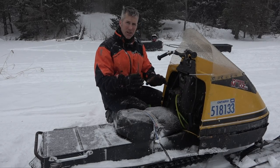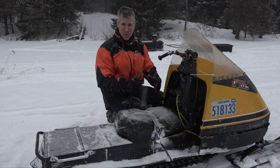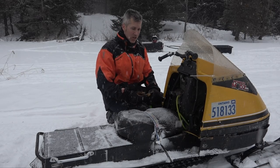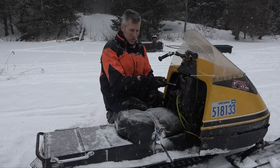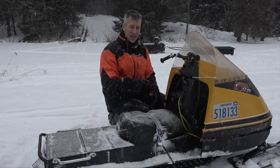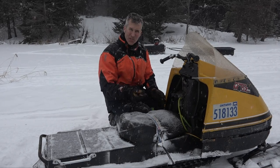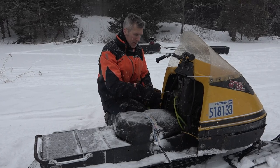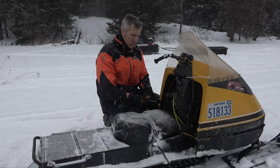They have all brand new Tillotson parts for these, not those aftermarket kits that come from whoever knows where, and they never work, you know? They're just not good, the needles are bad. Most of the time there's check valves in these underneath the little Welch plugs. They get stuck, nothing really works well. The pumps are poor, the needle and seats are junk. It just doesn't work. So anyway, I rebuilt this one really quickly.